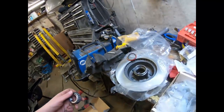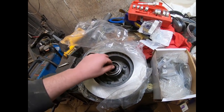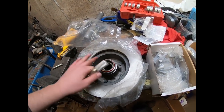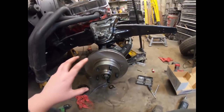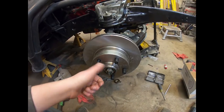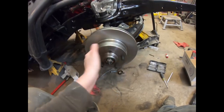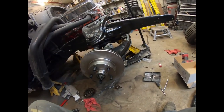The race is already in the rotor on this kit. Once you have your bearing full of grease you pack it, put it in, put your seal in — I have a little seal driving tool — put it on and hammer it down flush. Then you put it on the spindle, put a bearing, a little washer, and then the castle nut. Snug it up while spinning the rotor, loosen it, put it on finger tight, run your cotter pin through, and put your dust cap on.